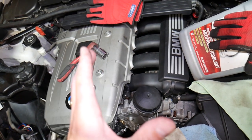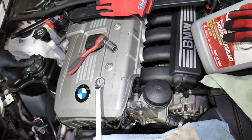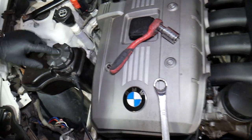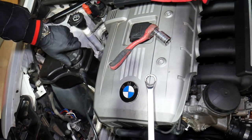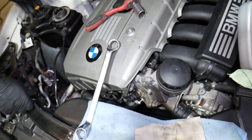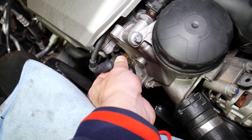If you have not driven the car for overnight or 24 hours, your engine will be cold. That way you will not get burned by the coolant. You will need to find your Z4's coolant radiator cap and slowly remove it to release the pressure out of the system. Then disconnect the wire on the sensor — press in and pull it out.